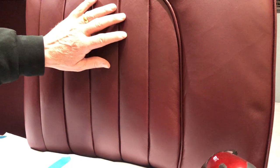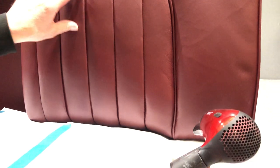Because you're obviously putting a lacquer on there. Once it's got a lacquer on it, you can't feed a lacquer. You can protect it against UV rays and things, which is what people have this misconception about with leather. You need to put a protection cream on to protect against UV rays and dirt buildup. Because the more dirt, grease and grime you get on the surface, the more that's going to attract dust and particles of dirt, maybe sandy type material, which will create an abrasive on the surface, and that will then start abrading the actual coating on the surface away, and that's why you end up with seats that are all worn with wear patches showing through where there's no colour on them.